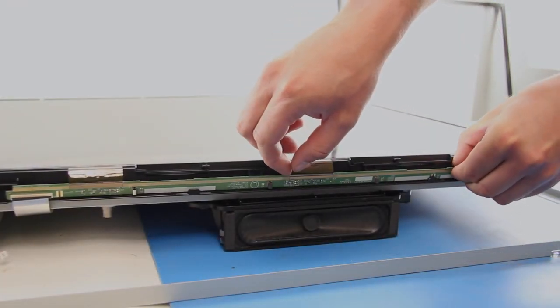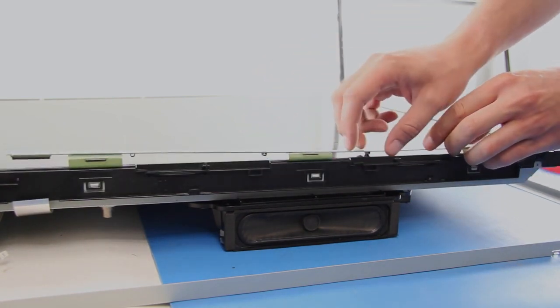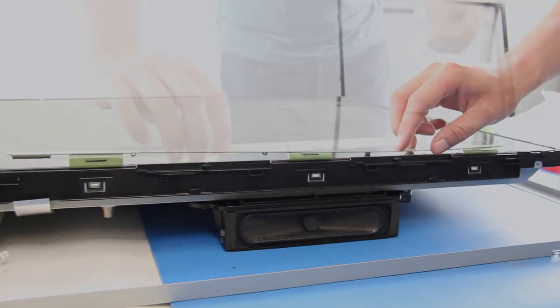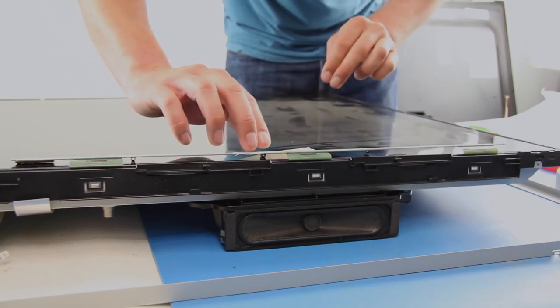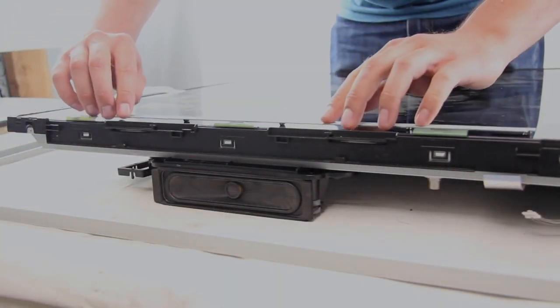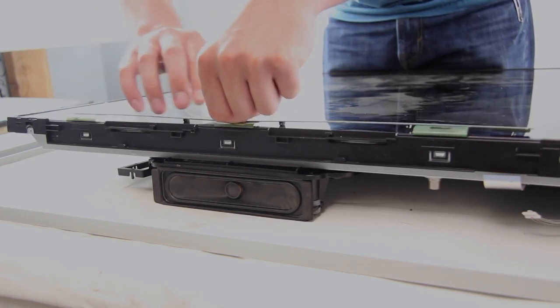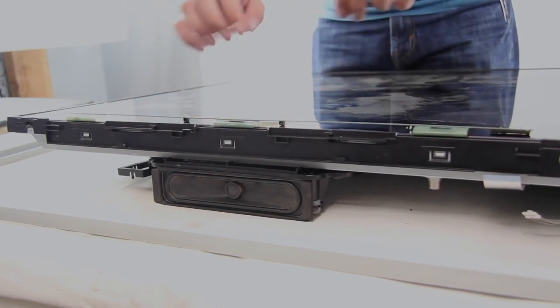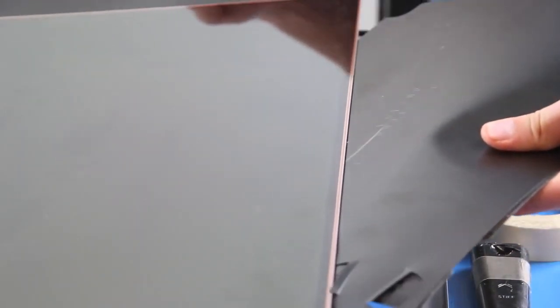Slide the scan boards out temporarily and tape them to the panel. The TV panel is fragile. Be sure to be very cautious with the panel to be sure it does not crack or break. Use two thin pieces of plastic or something similar to get underneath the panel. Be sure not to touch the underside of the panel with your hands.